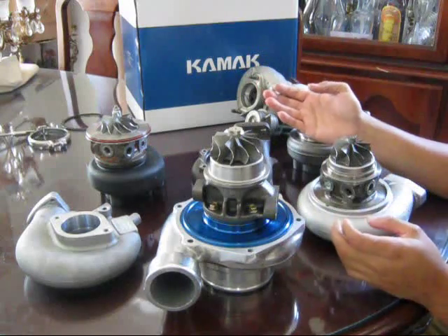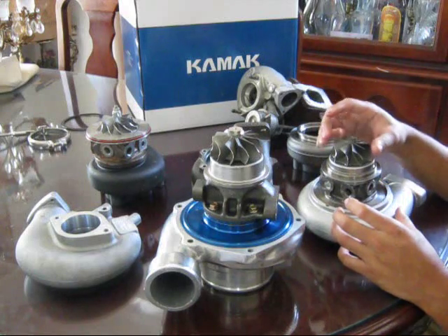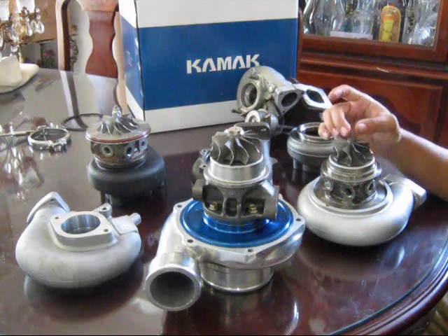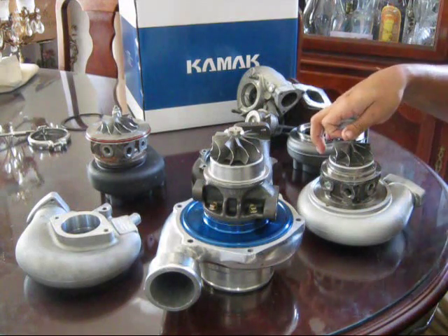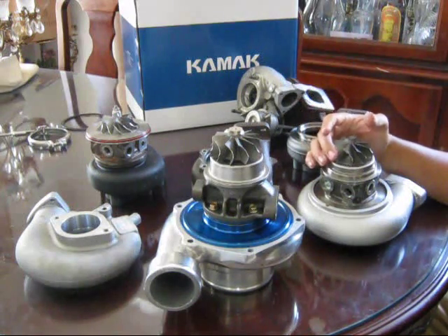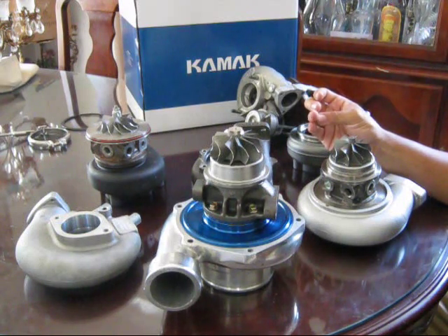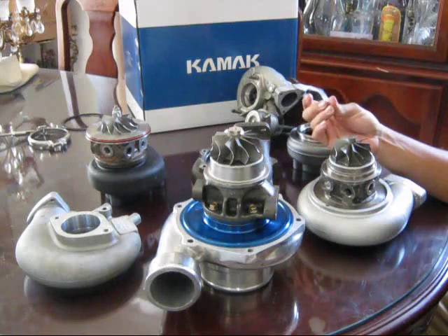You use the calculator to match a turbo, which is what I did to select this TD-0620. This turbo matched up fairly well for 15 pounds of boost with minimal lag — the old Godspeed spooled up around 3500 to 3700 RPM, which isn't too bad for its size — and it can flow up to 25 pounds and still be within its efficiency island on the compressor map. There are tons of threads and articles online explaining how to use a CFM calculator paired with a compressor map to choose the right turbo for your application.